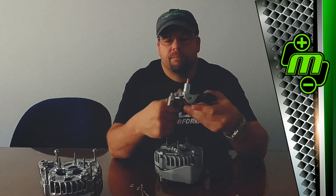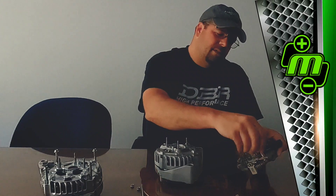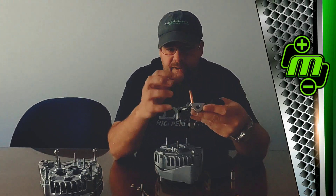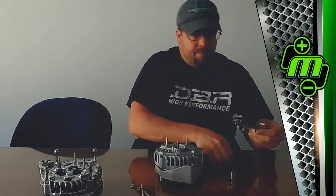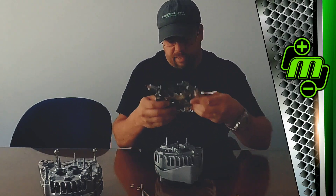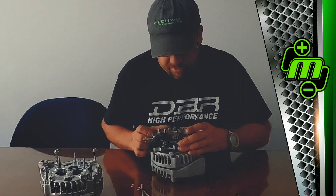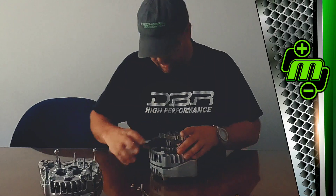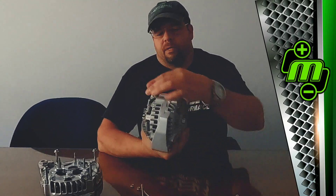There's a pressed-in stud on the back, and there's also a spot on the top — these rectifiers we use come with the hole already there. You take the collar nut off, press the stud out (it has to be done right with proper spacing so you don't break the rectifier), and press it back in the top, then put the collar nut or washer back on. There you have it — now it's on the top. It only goes on one way. It's a very precise fit. Now we have a 2014-and-up Silverado, Tahoe, Suburban configuration where it comes out the top and clears everything.